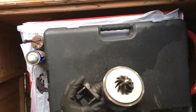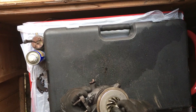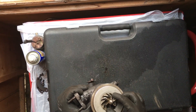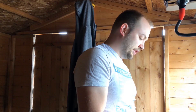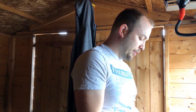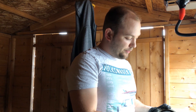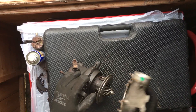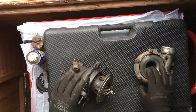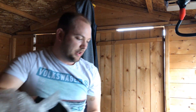You've got the old Garrett turbo from the Saab 9-3 as I showed before - the turbine is extremely loose, the bearings have obviously gone along with the seals, so it needs replacing. There is a significant amount of damage to the turbine - it's very bent. By the looks of it, it's caused quite a lot of significant damage to the housing as well. When it was on originally, you could see it was actually touching the side of the housing. So we are going to scrap that - we've got a replacement TD04 turbo.